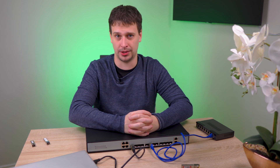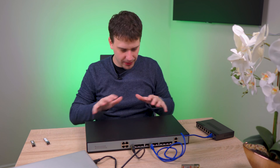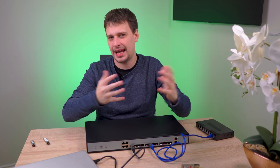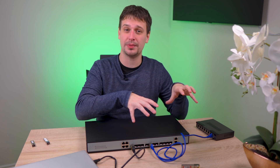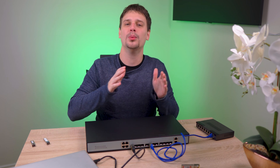SFP56 does 50 gigabits per second, but also just over fibre or DAC. And there is also SFP DD, which isn't used yet but will do speeds of up to 100 gigabits per second. The good news is all of those are backwards compatible with each other, so you can use a 10 gigabit connection with an SFP56 port if you like. And although everything is standardized, mixing manufacturers isn't recommended as it can introduce some quirks. There's another standard called QSFP which gives four lanes per port, so QSFP Plus will do 40 gigabits across four 10 gigabit lanes in one port.